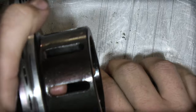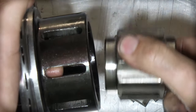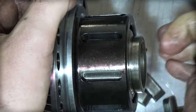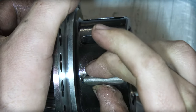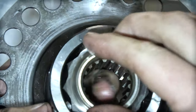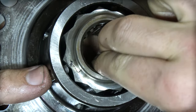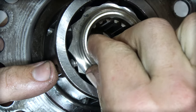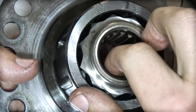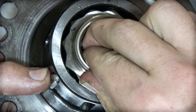Under drive, these metal rectangles hook up against the cams and that's what drives the wheels. When there's no drive, the pawls can move freely in and out and ride over the surface there — and that's what gives you an open diff. Then under load it catches on the edges of both the inner and outer races and locks it up to give you lock out of the corners.